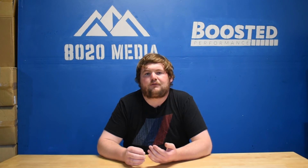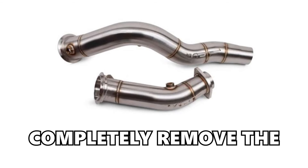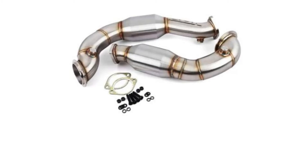There is one big differentiation between aftermarket downpipes: they will either be catless downpipes or high-flow catted downpipes. Catless downpipes completely remove the catalytic converters, resulting in the absolute best performance and power gains and a louder exhaust note. However, catless downpipes aren't street legal in the United States — even a visual inspection at emissions will trigger an instant fail. High-flow catted downpipes, on the other hand, will still pass emissions since the catalytic converters remain in place. However, they won't reduce back pressure as much, so power gains will be slightly lower — you can probably expect somewhere closer to about 15 wheel horsepower.